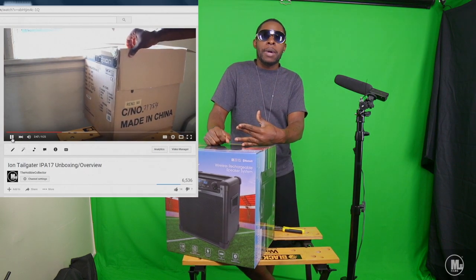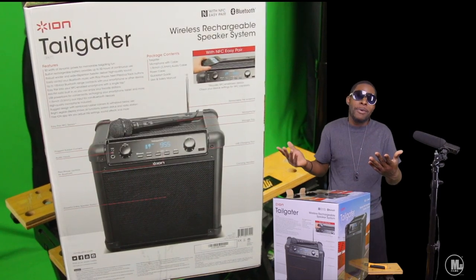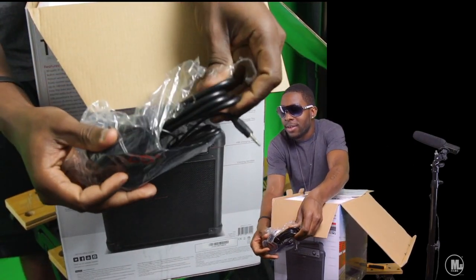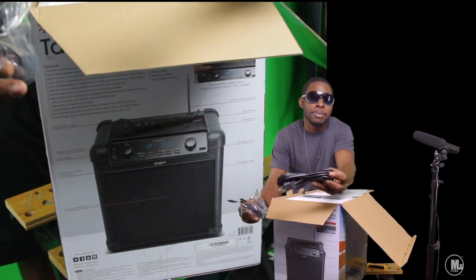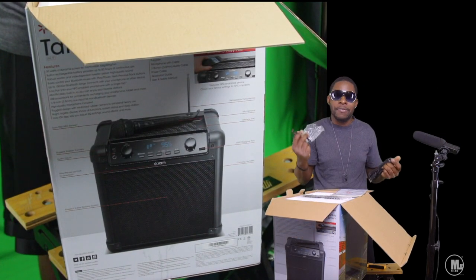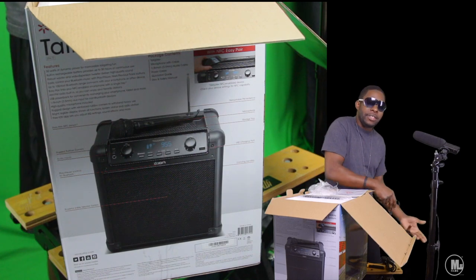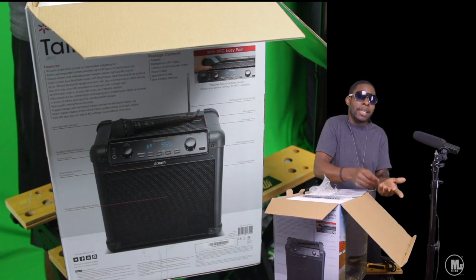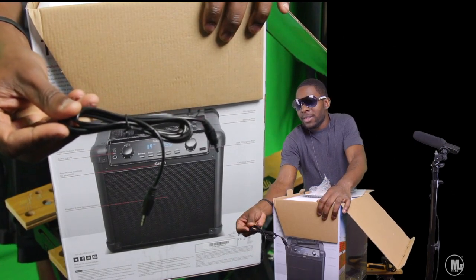I mentioned in the first video how the knobs are real smooth. I did leave this thing out in some light rain for a little bit, which could be the reason why sometimes when I'm pressing the skip button to fast forward through the music, the LED screen will glitch out and the buttons won't work — it just shows nothing but zeros on the little screen and won't respond. But the time I left it out in the rain was a long time ago. I filmed a whole video about it, gave commentary letting people know, and then tested it on camera to see if it would turn on — and it actually did. It's still working perfectly fine. The only way to confirm water damage would be to tear it apart and check for corrosion.